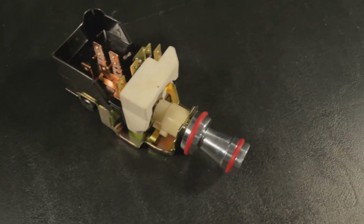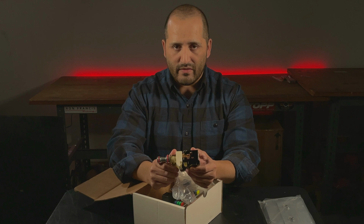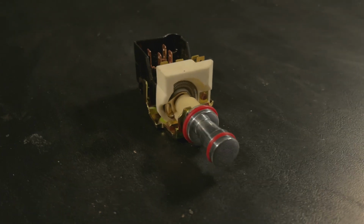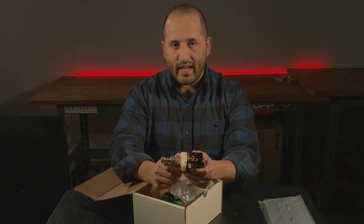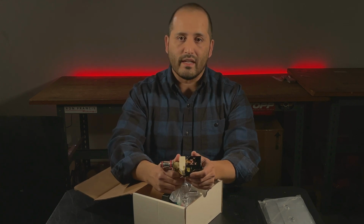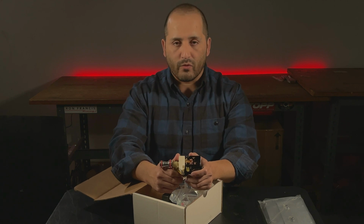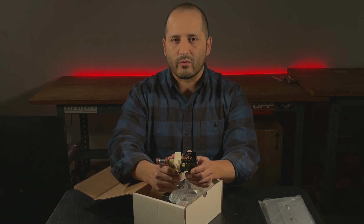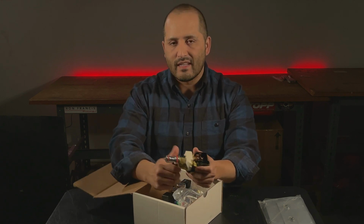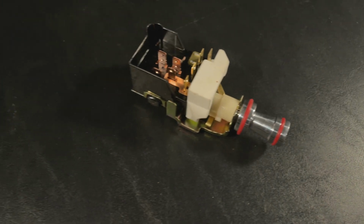again, this is like the Mustang type of setup. I'm not using any of the vacuum hoses for the headlights on my vehicle. I haven't talked about that much, but I want to convert that to electronic versus the vacuum operated headlight flip switches. I think that's pretty cool, but I want something more reliable, so I'll be switching that part over. There are some actuators that you can build yourself for a DIY approach. They're Ford Probe actuators, or the Corvette C4 I think, or C5 actuators can work too as well. And you can build a bracket and do that part of it. So this doesn't have all the vacuum hoses to that, because honestly I'm not going to need it.